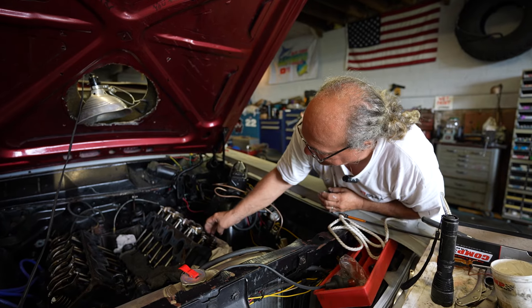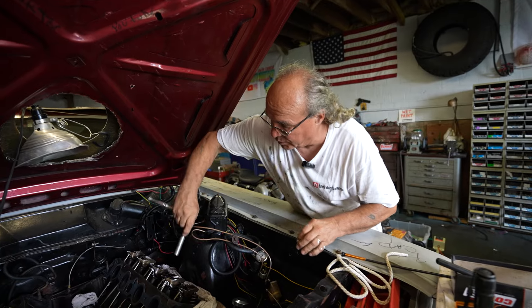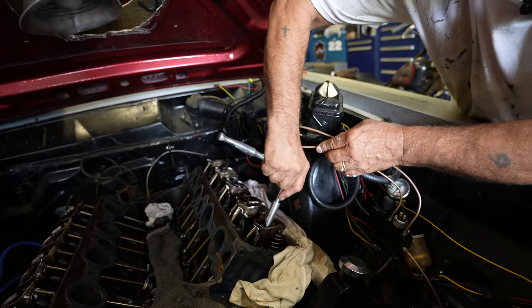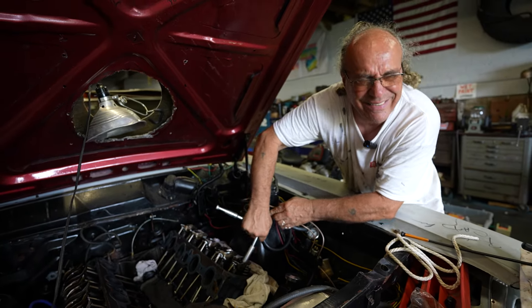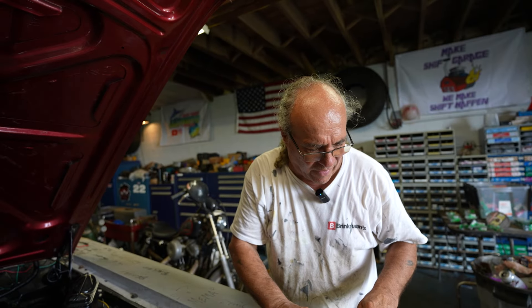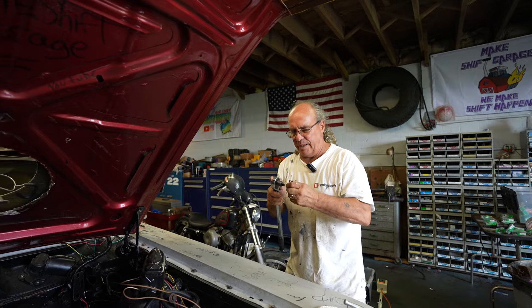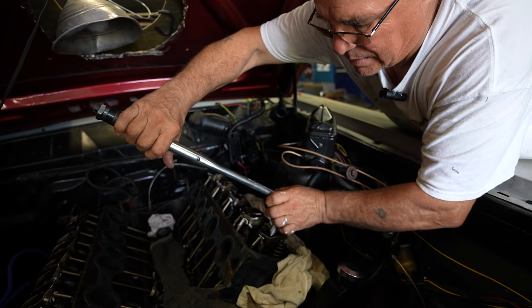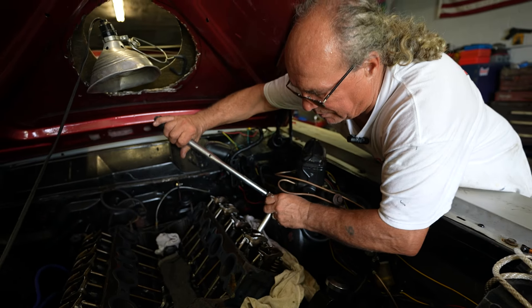That's it — now let's put it back together. Pushrods in, get the wrench on there. All you've got to do is snug it up by hand and then torque it down. They say between 18 and 23 ft-lbs; doing 25 is fine. Old bolts — let them stretch in there if they're already stretched, but 25 is good.